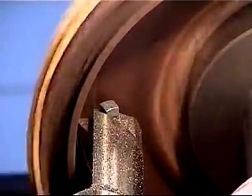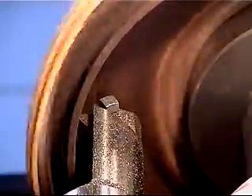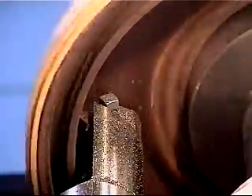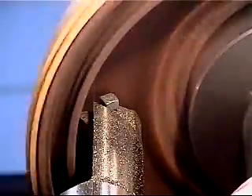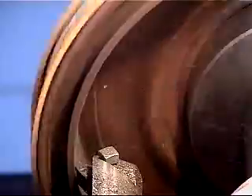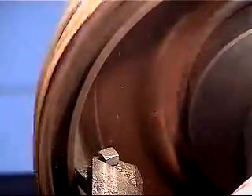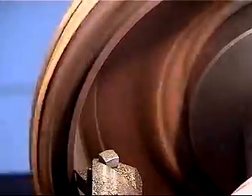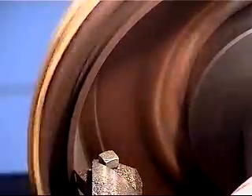Move the cutting tool into the corner of the drum, taking care not to force the bit into the face of the drum. A noticeable change in tone can be heard when the cutting bit reaches the corner. Set the depth of cut and feed rate, then engage the drum feed. If the drum needs another pass, repeat this process, measuring the drum when necessary until a smooth surface is obtained.